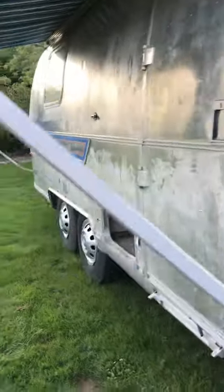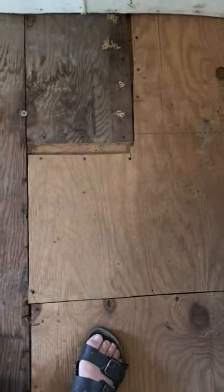Okay, there's not a lot in this trailer because it has been gutted out. Moving into the trailer, the floor is actually very solid throughout. The walls need painting or relining from scratch — those are the options open to you. The floor at the back has been replaced, but very badly, so this will be included in the price — we'll take that rear floor out, have a look at the chassis, and basically replace it and do the job properly. Having said that, there is no floor rot at all down by the door, which is normally where they rot really badly, and we don't seem to have any rot or sign of damp.